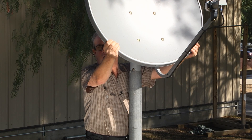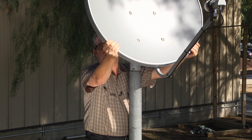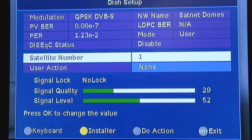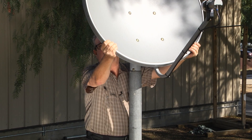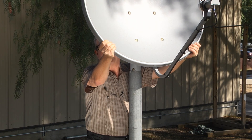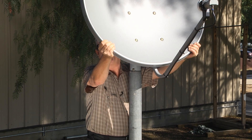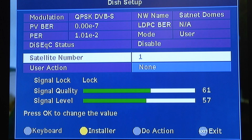Now the person inside goes to work. They'll be looking at signal quality and signal level. Slowly move the dish toward the landmark even more. The person inside should tell you if they're seeing a stronger signal. Continue very slowly moving the dish. They see increased signal level and signal quality. Continue to move it. Now the person inside sees decreased signal level and signal quality, so slowly move it back to the position you were at before. Now the person inside says they have maximum signal level and signal quality.